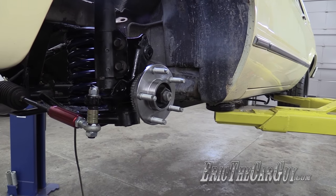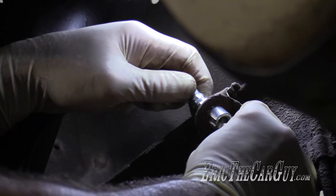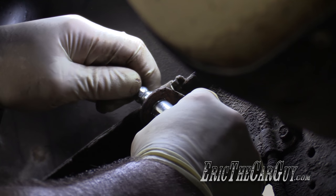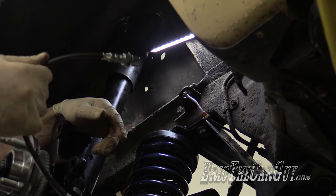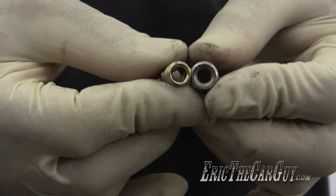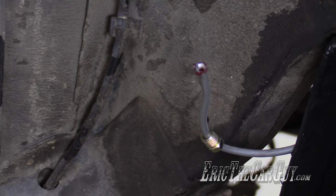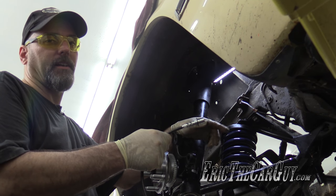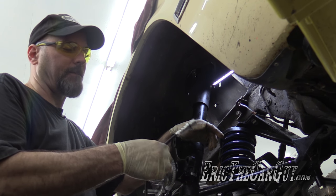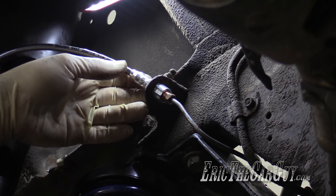Feels nice. Before I get too far, I'm going to install my brake hose. Well, I just made a very important discovery. Before I started shooting, I tested to see if these lines would screw down on here, and I found out that the size of fitting was not the correct size for these lines. I changed both fittings, and now I come to find out that one of these lines has one size fitting and the other side has the other size fitting. So I had to go back and redo the fitting on this side. Not happy about that. Anyway, we now return to our regularly scheduled brake line installation already in progress. Works really good when it's the right size.